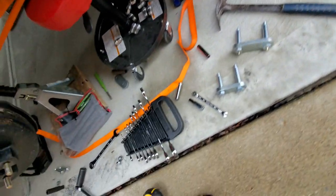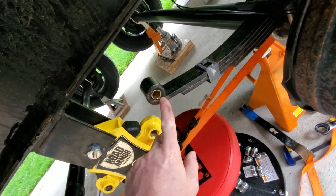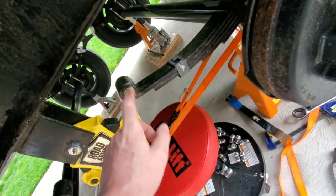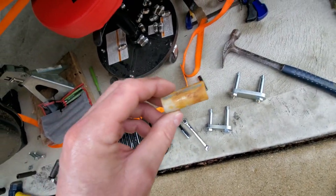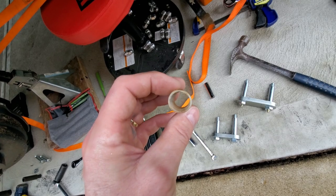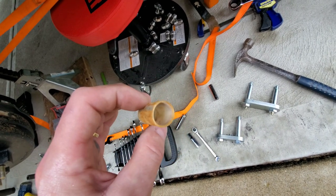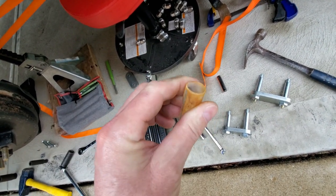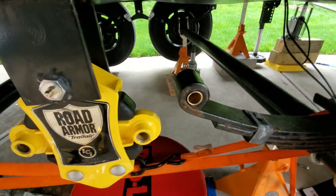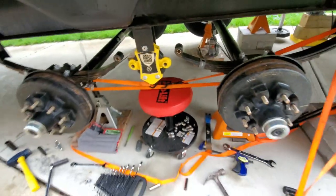I also went ahead and ordered new bushings that go inside of these curled spring leaves. These come from the factory with nylon — basically plastic — and this thing has less than 500 miles on it. It literally went from the manufacturer to Trenton, Ohio to Westchester, Ohio, and this is the absolute crap you get from the factory. So I'm going back with good bronze bushings and wet bolts so I can put grease into these wear points and reduce friction.